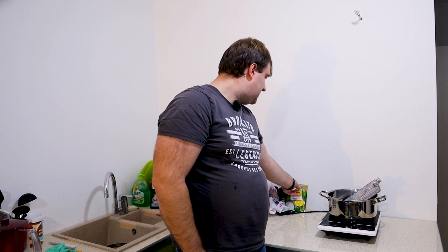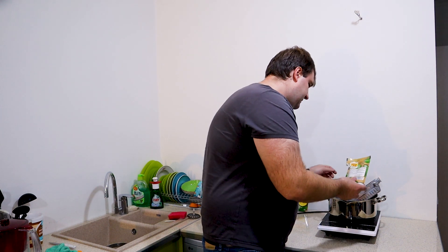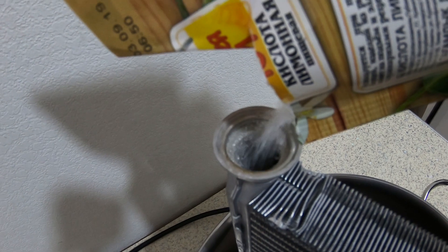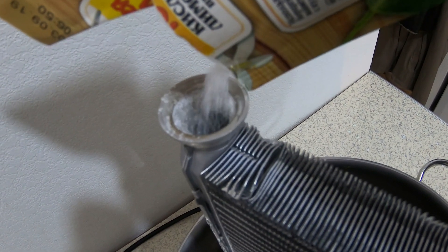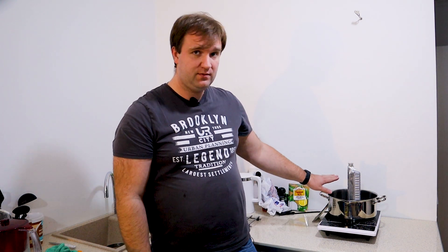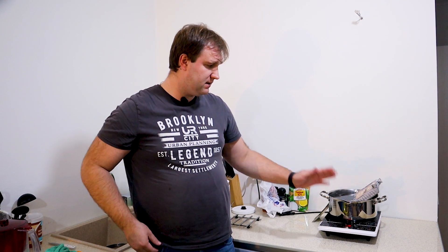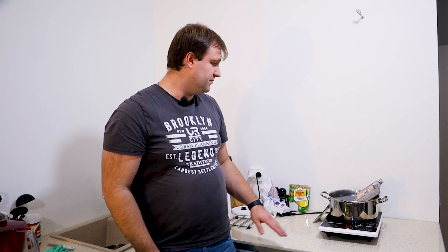What will we do now? We take this wonderful product called citric acid. We open it and carefully pour some into the radiator itself. We've poured in the citric acid. Now we'll fill a pot with water, pour some water into the radiator itself, and boil it. Water poured in, pot and stove turned on to heat. We wait. Notice that the water here only covers about half the radiator.